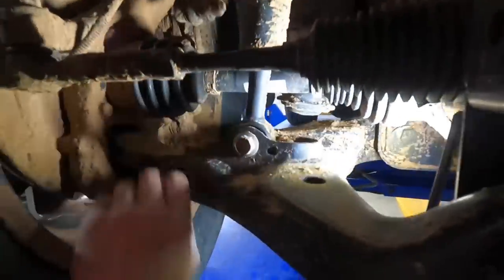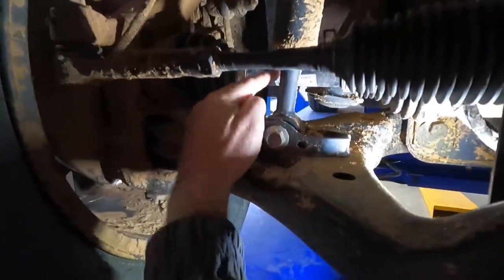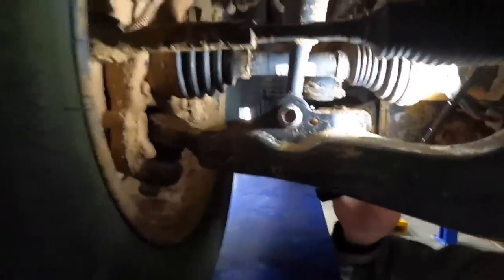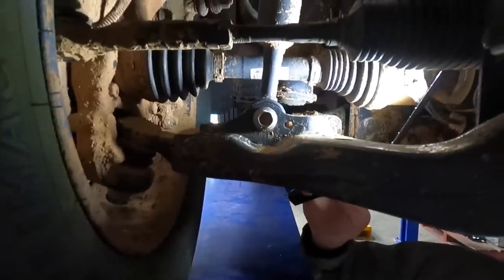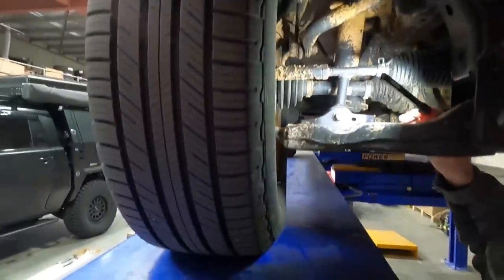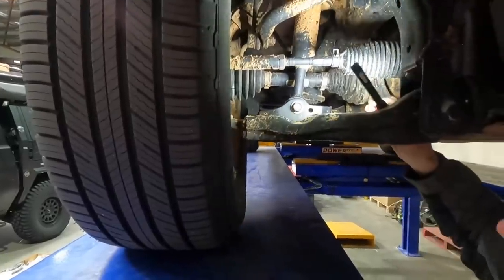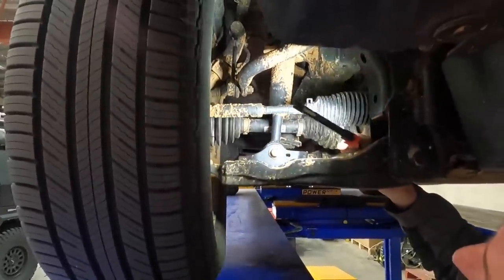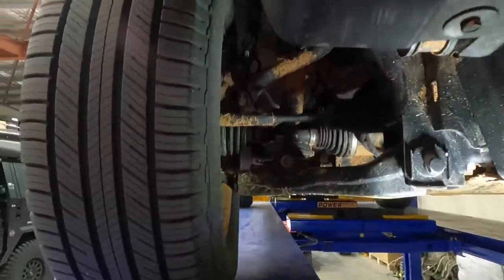What are these drive shafts like? Look at the thickness of these. That's almost like Patrol ones. Your drive shaft's thicker than your strut — that's going to break. That looks like a weak point — that's going to bend for sure. Very flat angles. Well, that's because it's standard. I know, but we'll fix that too. There's another sway bar we can get rid of. This thing's going to have some good flex — like extensions and all that sort of thing.